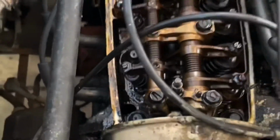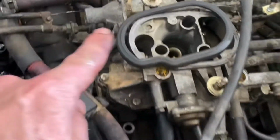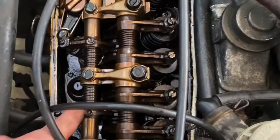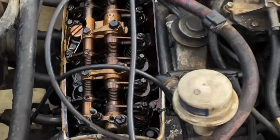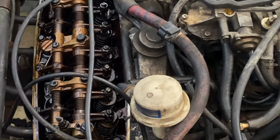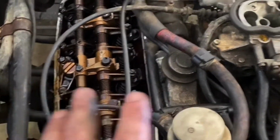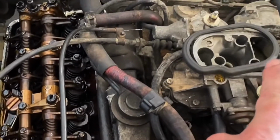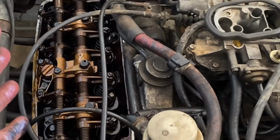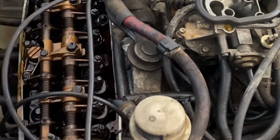It is basically a small intake valve that is only fed by this tiny barrel. There are four individual runners that come through this intake that go to each one of these valves, and it just gives you a rich mixture in a pre-chamber, not unlike an older diesel where the glow plug goes into a smaller pre-chamber, heats that up, then kaboom. This one, however, means you can run leaner mixtures off these other two because you've already lit this richer mixture and the flame just spreads across into the cylinder.